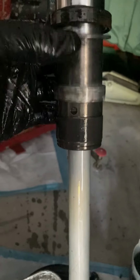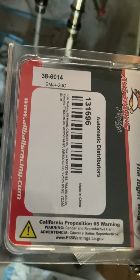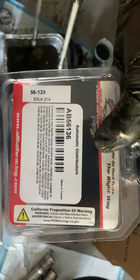I've got a bushing here. This probably stays with the unit. Got a washer. I've got the fork seal, and then I've got the dust cover. To do that, I've got two kits. Here's a rebuild kit. You can see that in there's the bushings. This is an All Balls kit. These are pretty much generic, sold for the diameter of the fork. I believe it's 43mm on this guy. And then here are the dust seal and the fork seal for the forks. It's a two-part kit.